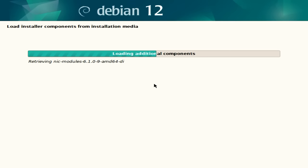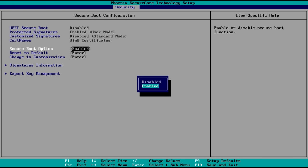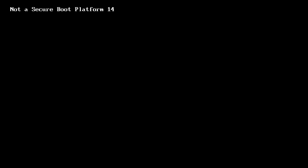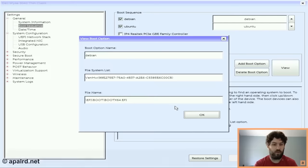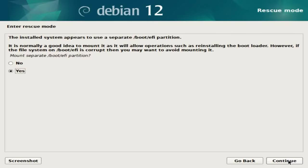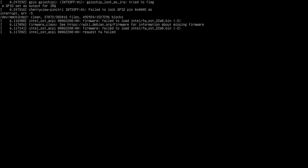For rough benchmarks, I installed Debian 12 and ran Sysbench to get an idea of CPU performance and power draw. Installing Debian wasn't always easy — the 5060 just needed USB boot enabled and secure boot disabled, but the 7010's BIOS had no option to disable secure boot; using a dedicated Debian 12 installer worked fine. The 3040 has a UEFI bug that doesn't play well with Debian. Huge shoutout to Pollard's Adventures, who covered the 3040 in detail and explained how to modify the Grub bootloader to fix this. After following his advice and using Debian rescue mode, I got Debian installed on all three systems.